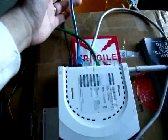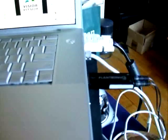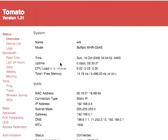The first thing you need to do is plug your computer or laptop into a wireless router or any sort of normal consumer-grade router. I happen to have a Buffalo Wi-Fi router. I have my laptop plugged into it, the router plugged into my internet connection, and the SPA-2102R plugged into the router as well.